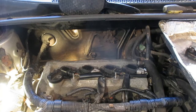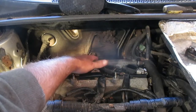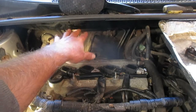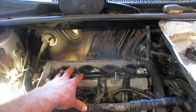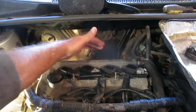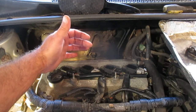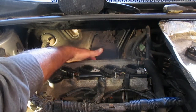When you're doing a job like this in a very cramped space, I'll do whatever I can to get a little extra edge. I removed the plastic cover off the top of the engine — didn't give me a lot more room but maybe half an inch. The instruction manual advises removing the bolts between the end of the manifold and the exhaust system first. Whenever I do something like this, I loosen off whatever bolts I think are most likely to give me a problem — in this case the bolts and nuts connecting the manifold to the engine block. Because if I start to loosen them and I can't get them, the job's over. We're going to loosen these bolts and nuts off here first.